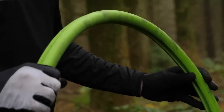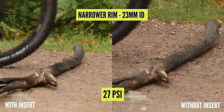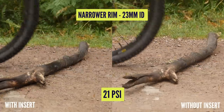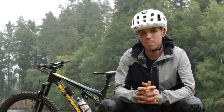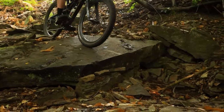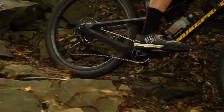There's a nice chamber at the top of the tire that is supple and grippy, but if there are any square hits, they won't go straight to the rim. What is the perfect tire pressure for me? On some trail casing tires such as these, on a rim like the FSA which is a 29mm internal, I'd probably hover around 25 PSI for the back and maybe as low as 23 for the front. If I was to go narrower, would my tire pressures go up? Absolutely — if only for that once-in-a-blue-moon occasion where I hit a rock a bit faster than I was anticipating or I'm unable to weight the bike. That might only happen once a ride, but if it does, it's enough to ruin the ride. So our tire pressures have to anticipate such an occasion.